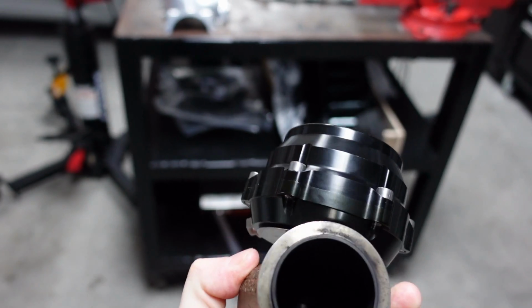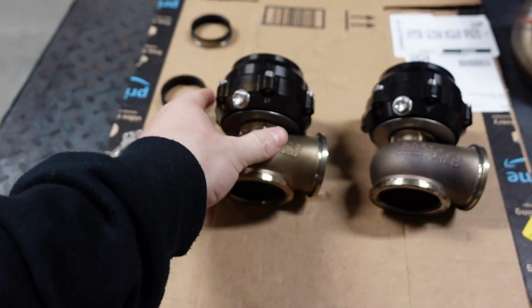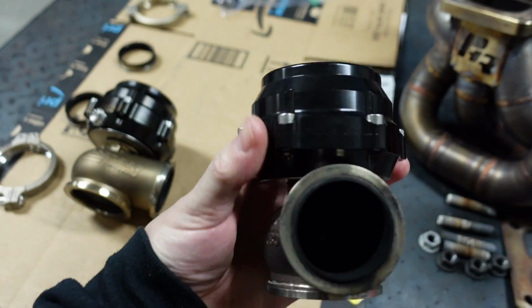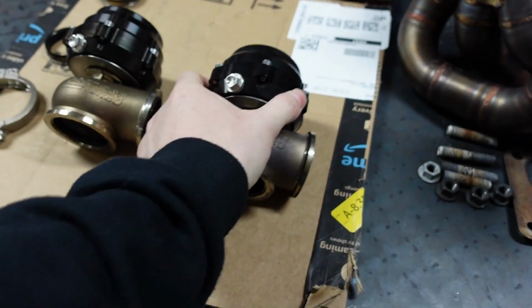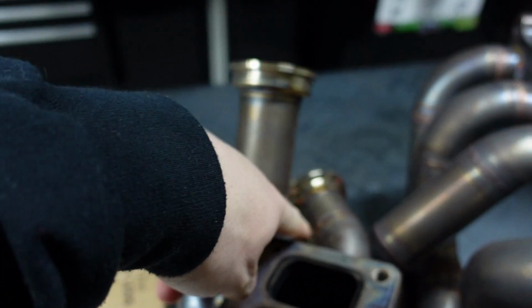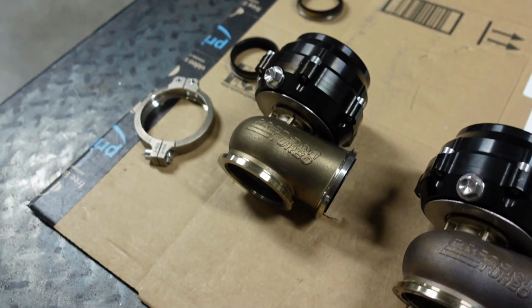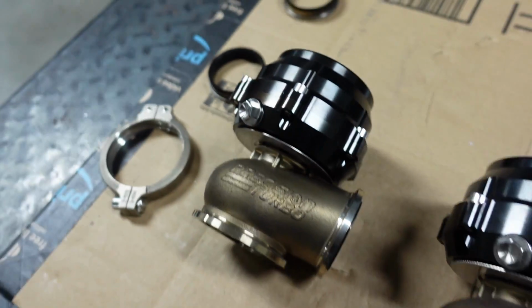So I thought it was heat. I really do think, guys, anodizing, it does tell you this too. It's 100% the light, the UV rays are killing it. This gate's the one on the bottom, and look how black it is. Nice and black still, and that sees more heat. This one that's further away, this one that's closer to all the heat, did not discolor. So heat didn't kill it. It's literally UV rays. I love anodizing. I think it's awesome, but damn it, that sucks.